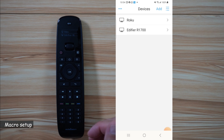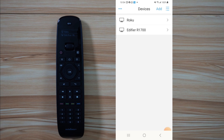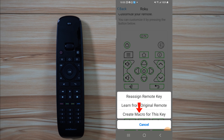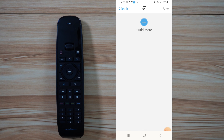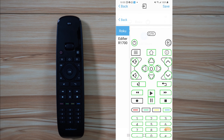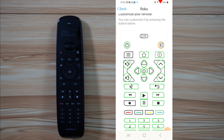What I want to do now is add a macro key so that with one button I can turn on or off both devices. In the application, tap on the main device you're going to use all the time — here I'm going to tap on Roku — and then tap on remote keys. Here I'm going to tap on the key that I want to assign as an on/off key for both devices. You need to choose a key that is not already assigned to any function for Roku. This is the input key here — it is not assigned to any function. I'm going to tap on it and then tap on create macro for this key. Here you add the keys that will be activated with this macro. Tap on plus and choose your devices from the left — I'll start with Roku, select the power on/off button, it is added to the macro. Now I'll add the Edifier and the power on/off button also. Then tap on save. The macro button is saved now.